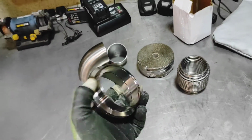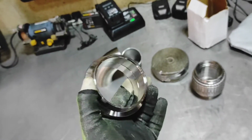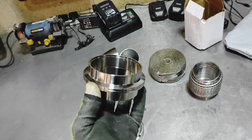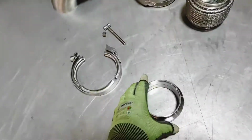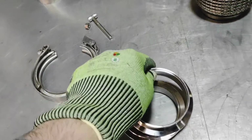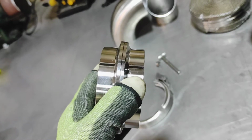And then I got these V-bands. I got 3 of these V-bands. These cost me €16 each, and what I found on local eBay that matched these was coming in at €33 each. So I think that's a win. They are male and female. This is what you want to be looking out for when you're looking for a V-band. Most of the ones you'll see that are €16 are flush. There's no male or female element to them. They're just 2 flush flanges.